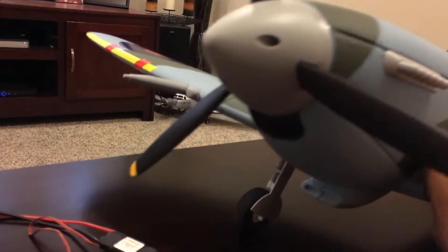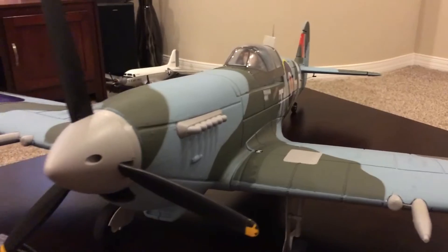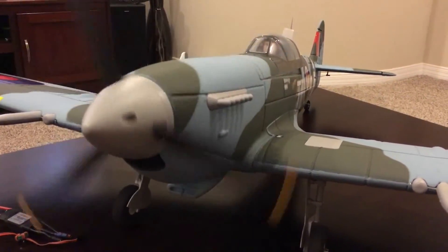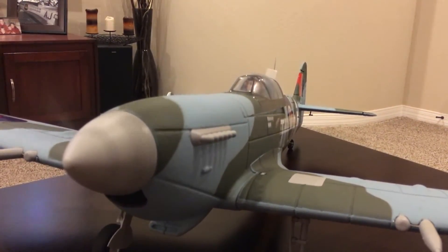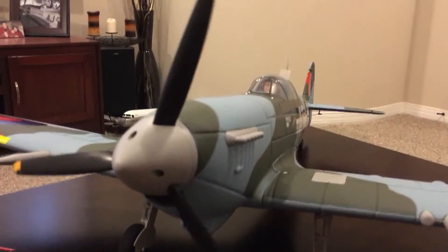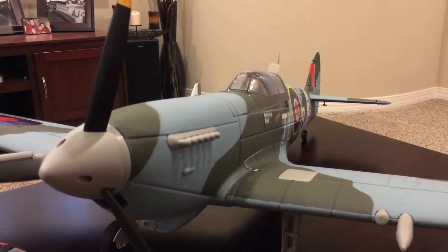On the back there's the egress hole — same thing, I colored in the white with sharpie so it doesn't stand out. There's black all over the bottom of this airplane anyway — servos, clamps, wheels — so a little extra black right there is no problem. There's the 50 amp ESC installed. The 40s and 50s do stutter when first powered on with the prop, but I'll live with it. I've got ventilation and a 50 amp ESC now so I'm going to really push this plane and see what it can do.